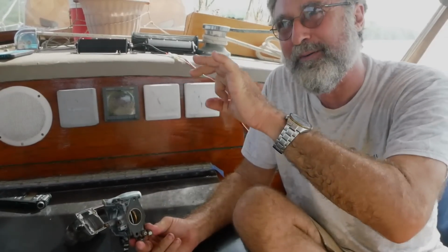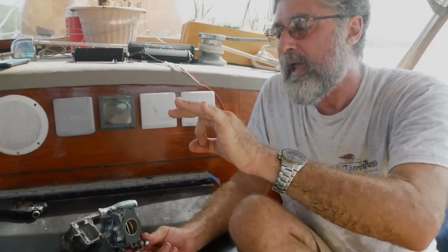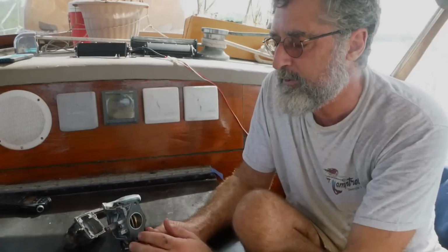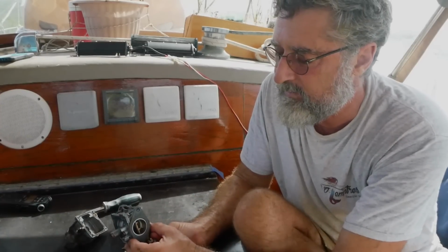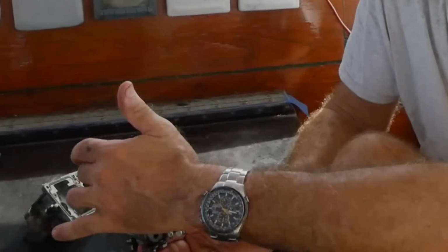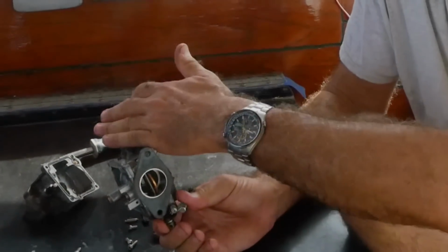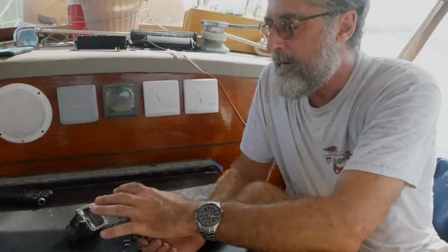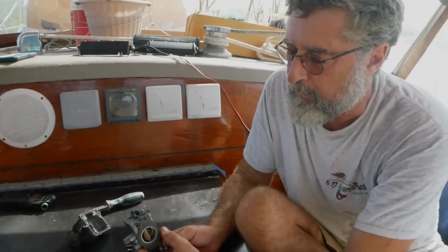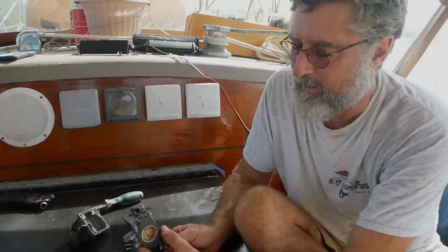You would think the pressure would go up. You're squeezing it, you would think it would cause back pressure, but it actually makes low pressure. And that area of low pressure sucks fuel up. And the beauty of it, once they built the carburetor right, is if you close the throttle plate, you'll have less air, less low pressure, less fuel. And as you let in more and more air, you end up with more and more fuel. Keeps everything in balance. That circuit, that just tube with a little hole, is really only used from about half throttle up. And Dale's problem is from half throttle down.